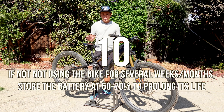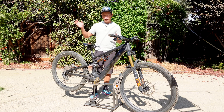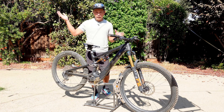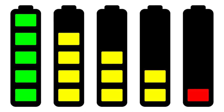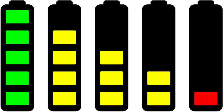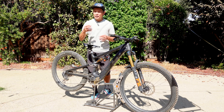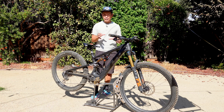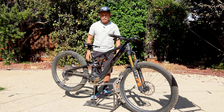Tip ten: don't leave your battery fully charged or fully empty during long-term storage — anything more than a couple of weeks. If it's winter and you won't use it for a few months, put it at a mid-level called a storage charge — 50% to 70% is the best situation. The battery won't degrade itself, and you have buffer room on either side if the voltage drifts. To get there, just ride for about half an hour on turbo, use your timer, or charge it to half of the normal charge time.